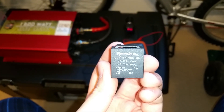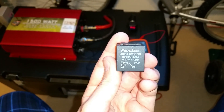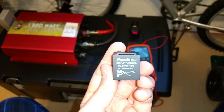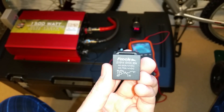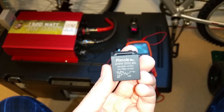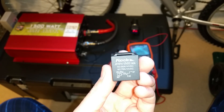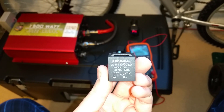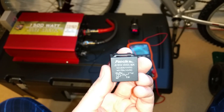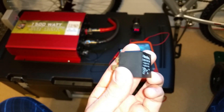For this project, I have a normally closed/normally open relay here — this is actually from the heated seats I intend on installing for my Honda Fit. The same type of relay I intend on using for the daytime running lamps. If you have an LED conversion kit like I do, you cannot install the stock daytime running lamp unit because it will cause problems with the pulse width modulation output.